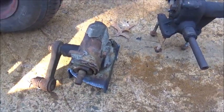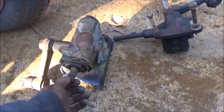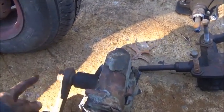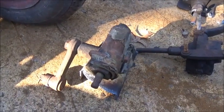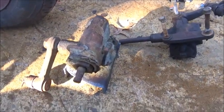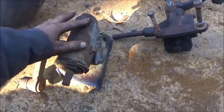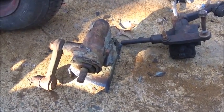This box is in really good shape — absolutely no play in it — and it was on a half-ton full-size pickup, so if it'll handle that it should handle anything we put on it. I really wanted to use the one I picked up from a buddy, but it sticks out too far. I also checked a '62 Ford Falcon parts car and it hung down too far, making it stick out wide. So the Chevy box is the best bet. We'll get it cleaned up, get it unbolted off its frame, and start trying to get it mounted, maybe get a steering column tomorrow.